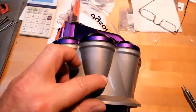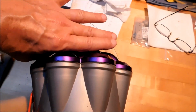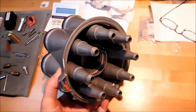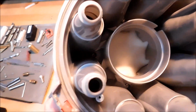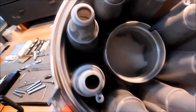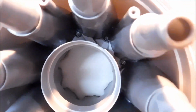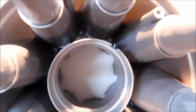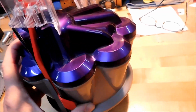There'll be a bottom housing, there'll be some type of diffuser ring in here, large plastic part, and the lid itself. Take those screws out to break this thing down. And believe me, getting them back in is not going to be a picnic. It's best served if you hold the unit sideways or slightly tilted and install the screws from the bottom up, or they're going to continue to fall off your driver. You could also put tape on the driver if you want to, or Play-Doh or clay or whatever to hold the screw on and just come straight down from the top. But that's how you take this apart.